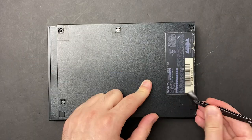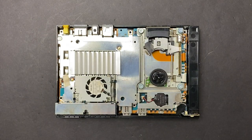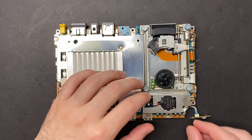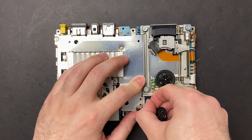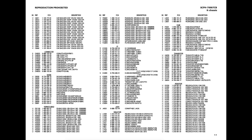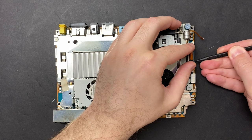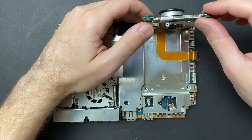Nothing left to do but open these guys up and take a look inside. I decided to start with the dirty PS2 — given it's got mismatched screws and it's missing all the screw covers, I might as well learn my way around the PS2 on this unit. That way if I happen to make things worse, I'm not going to be too broken up about it. I've downloaded a service manual for this system to help me out. My first thought is to check all the fuses — there are 14 fuses on this system and several could be responsible for circuitry that communicates with the optical drive. The fuses are on the back of the motherboard, so you have to do a full teardown and remove the lower shield to access them.